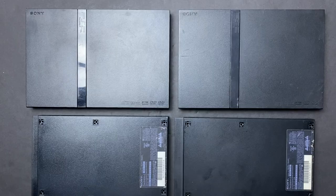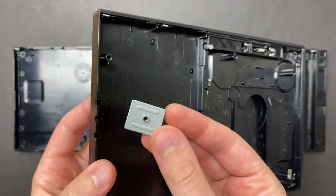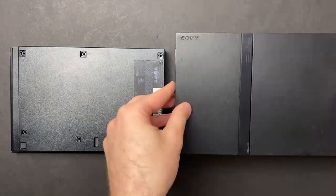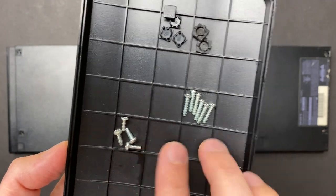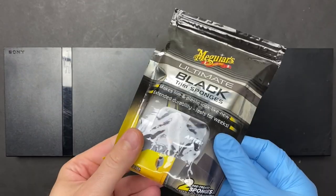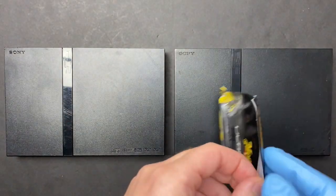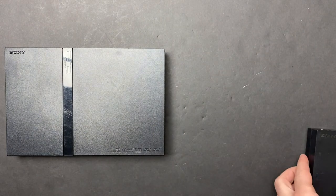These have been washed and we are ready to start putting everything back together. I'm going to keep them original to their board so I'm not going to mix and match. This piece is meant for the vertical stand if you stand the PlayStation upright — it slides into the top case. I only have six proper case screws between the two units, so I'll use three and three until I come across another parts console. I also applied some plastic restore — it's meant for automotive use on faded plastic. It replenishes the plastic with oils, lasts for quite a while, and it's going to conceal some of the surface scratches and make this thing look a lot better.